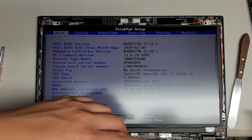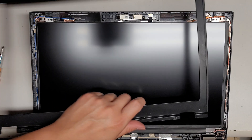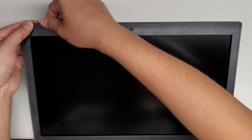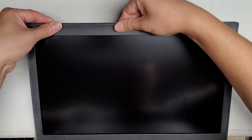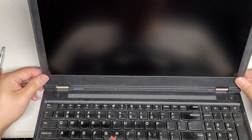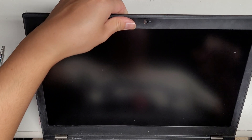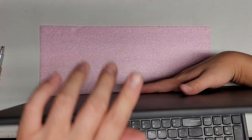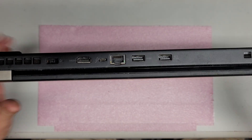All right, then put the frame back. Turn off the computer — on the BIOS screen you can press and hold the power button. Put the frame back in place: push from the top layer first, then the outer edge, and push down towards the center. The center part will clip itself; you just need to worry about pushing in the outer sides. I always like to put pressure on the back while I push so you don't flex the screen. Then close it, make sure all gaps are closed, and there we go — it's good to go.